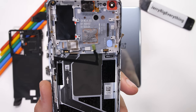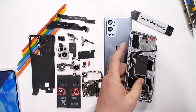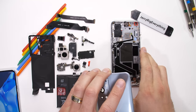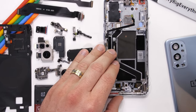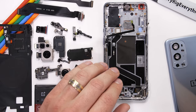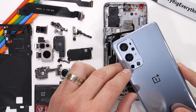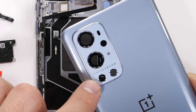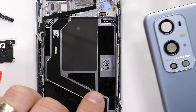We'll get a closer look at that later if we're successful in getting the phone to turn on. OnePlus is using an LTPO – Low Temperature Polycrystalline Oxide OLED panel. This accomplishes a few things. One, it's thin enough that the heat from the phone escapes through the screen. And two, it can dynamically change its refresh rate from 120 Hz all the way down to 1 Hz, depending on what the phone is doing, which should help out the battery life considerably. Speaking of which, let's start building the phone.